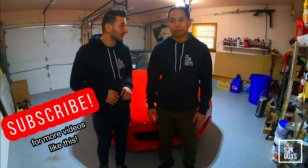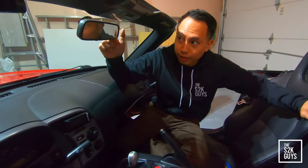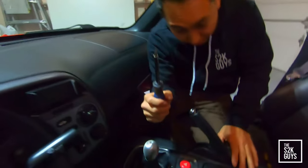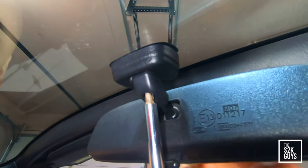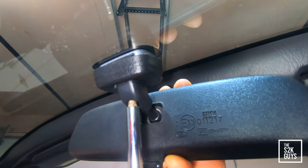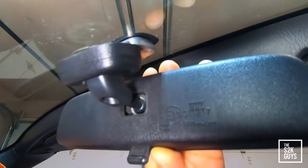Let's see what things look like in the rear view mirror. Alright guys, so we're going to go ahead and remove the OEM mirror. You need a Phillips head screwdriver — there's one Phillips head screw that holds the mirror and the bracket on. You want to unscrew it counterclockwise, lefty-loosey, righty-tighty. And now you just slide it back and there, the OEM mirror is off.